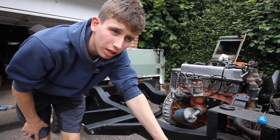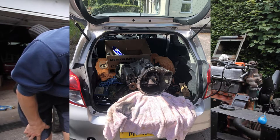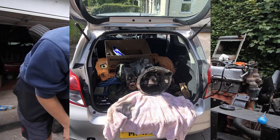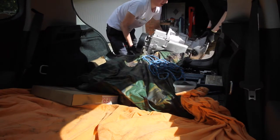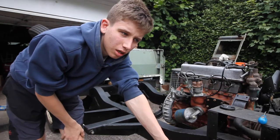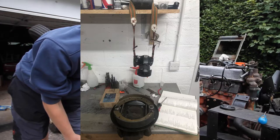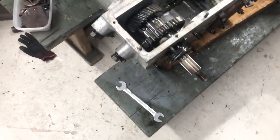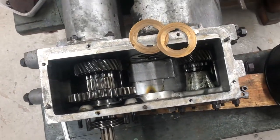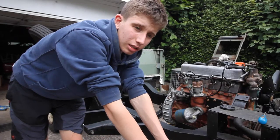Gearbox mounts are just put in. I moved the gearbox over this morning in the back of the car, which was a bit of a job but works alright. Next job is the gearbox in, and then hopefully the bulkhead should be coming this afternoon. On the gearbox I did rebuild the handbrake and speedo cable, and generally cleaned it up. I also checked the shims on the gear between the transfer box and the main box, just because they wear over time - just to check the amount of play. That's all set up and the whole thing was cleaned with some paint on it.